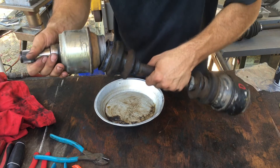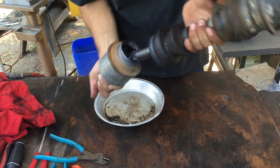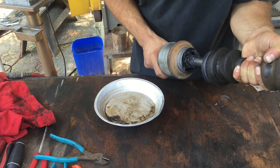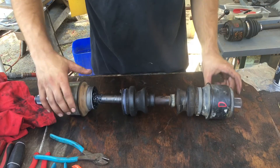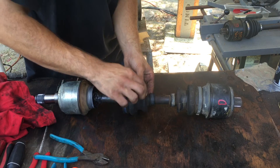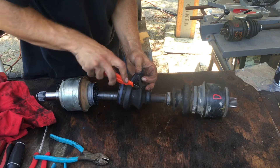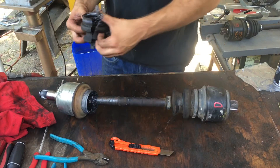This one still has good grease in it — there's the joint. This one actually feels pretty good. There's no play in the rotational direction, but it's nice and free, not binding. So you can cut off the old boots. Some of these old boots have a metal ring in this part of the boot right here, so I'm going to cut that. There's your boot — throw it away.